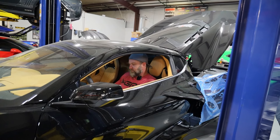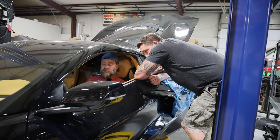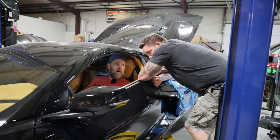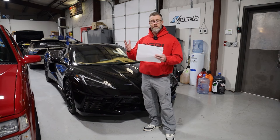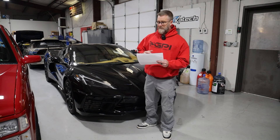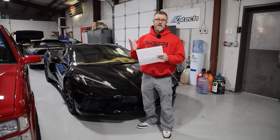It runs! I haven't done anything with the neural network stuff yet. I didn't make any fuel changes — just idle changes to start it up and log it. Basically I wanted to maximize our build potential for 6,800 RPM and below. Since the transmission control module is not tunable — zero controls — it seemed as if I was running into a fuel shutoff that was not engine tuning related at 6,800 to 6,900 RPMs. So I needed to maximize my combination from basically off idle to 6,800 RPMs.